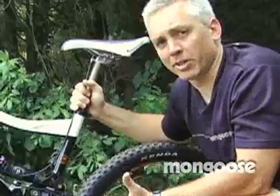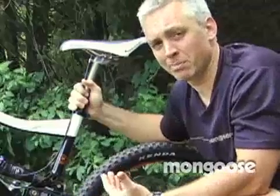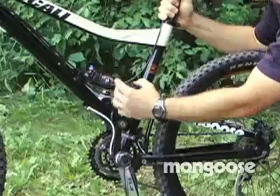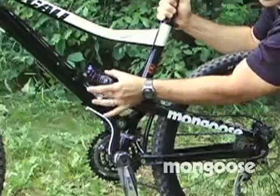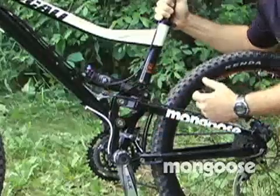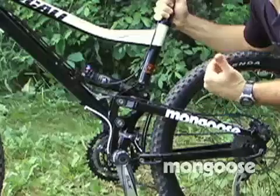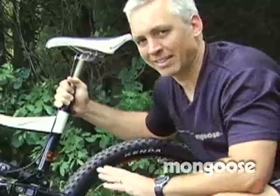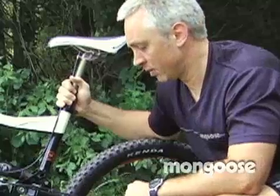One of the things we've done with the free drive over the years is we've learned more about leverage ratios. We've actually been backing off the amount of force that is needed to activate the shock, going to these oversized air canisters, which require lower pressure. And what that does for us is it gives us a very supple movement over the choppy stuff, yet still gives a nice ramp up at the end and handles the big hits fine too.